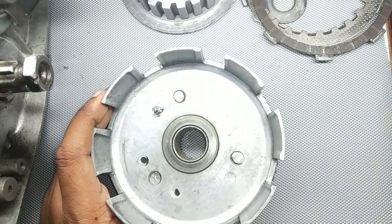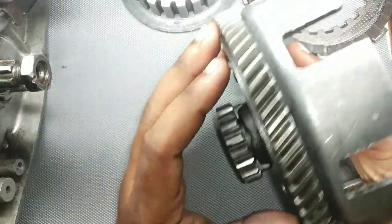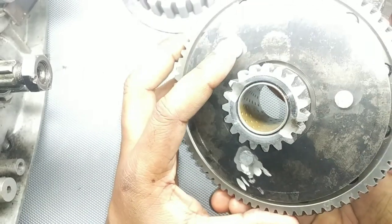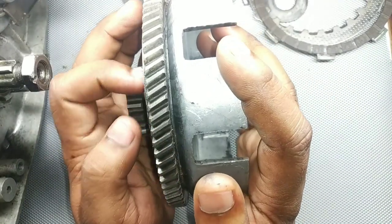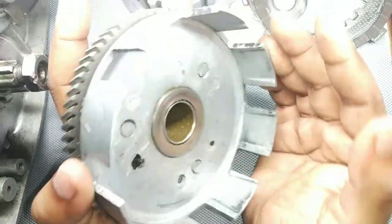In the new basket market there is an aftermarket option available. If it's original, that's a good thing. The first noise is coming from the bell and the rivets. If you are getting noise from the rivets and because of the play between the boss and the bell, then you need to get all those damper rubbers changed and get it re-riveted, and it will be fine and soundless.